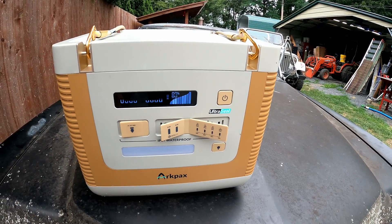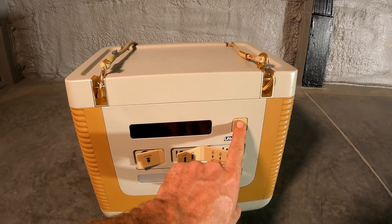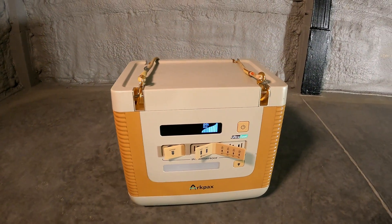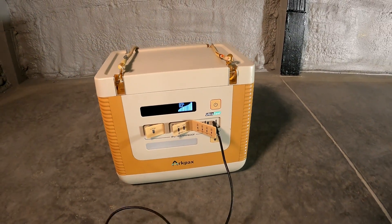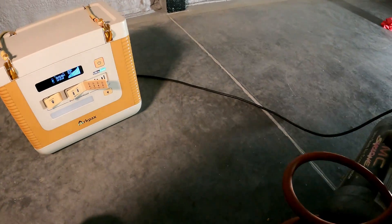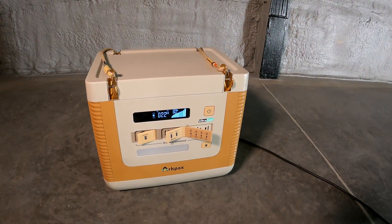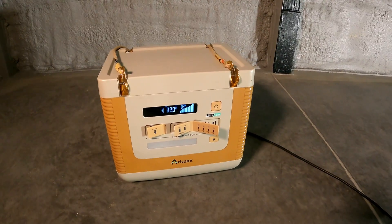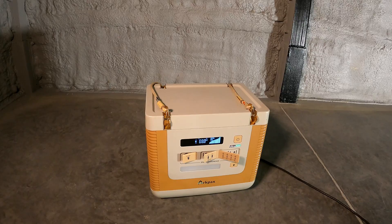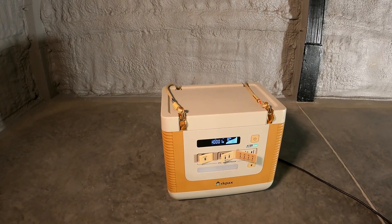I don't know how long it takes — I would imagine until it's just fully dry. It's a pretty humid day too with the weather. A couple hours later I see the machine has shut itself off. Let's try powering that up. We're not showing the water symbol anymore. Let's first try out the USB — see if that works. And yep, that's a-okay. Let's turn the outlets on. Got the beep. I've got this little compressor, let's try to kick it. Boom — it has survived a submersion. One minute. Delaware River. Seems like a pretty good unit. Time will really tell. I suppose the next thing I could do is take it all apart and see if any water actually got inside, but looking at the other video it seems those components are all completely sealed off, so I don't want to break the glue bond. I guess I'll just see how it holds up in the future.